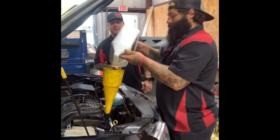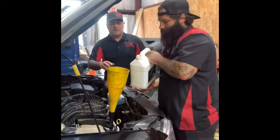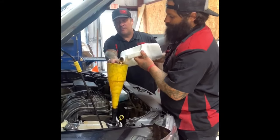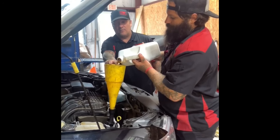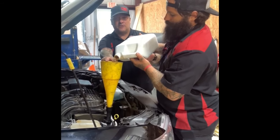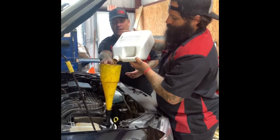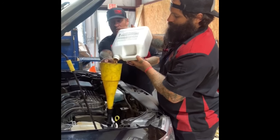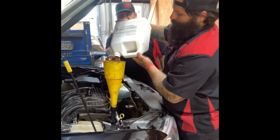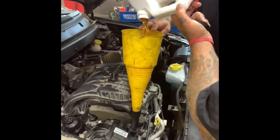We're also going to put in the 44K. The 44K goes into the gas tank — as it goes through the gas tank it's going to clean the fuel system. It's another great product that we use here on a daily basis. We install that 44K and it helps to clean the injectors and helps get the inside of the cylinder cleaned on the motor. What that translates into is better fuel mileage and also helps with how well the engine runs and idling smoother. You can see there's quite a bit of engine cleaner that we're adding — there's no oil in the engine.